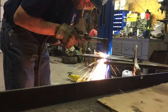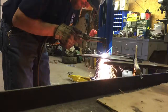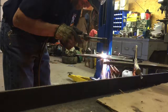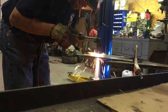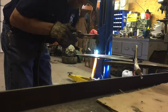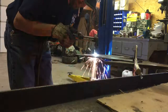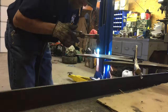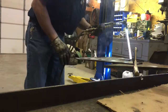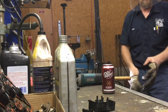After I laid them all out on the pattern — after I torched them out — I went back through and measured and marked everything, laid it out square so that all my slots, the edges of my slots, were all parallel. That is very, very important with these parts because if they're not, they will not work.